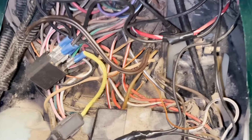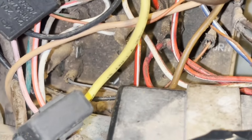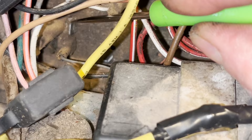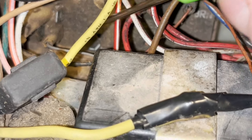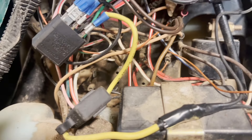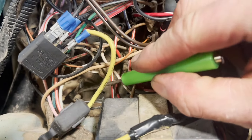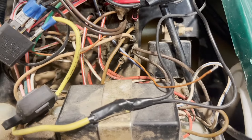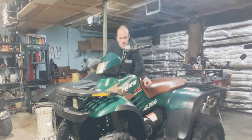The place where this should get power from — as we zoom in here — is these two ports here. There's one here and one here. The top one goes to the left front, the bottom one goes to the right front. The grounds are right over here. So if you decide you want to run a new power and ground setup, those would be your access ports — one and two, and then in the second row, one right above it, two. You can run brand new wires if you want. I'm gonna go ahead and solder these up. If you need information on how to solder, click one of the links down below — I'll show you how a real badass solders. All right, let's see what we got.